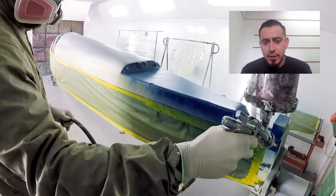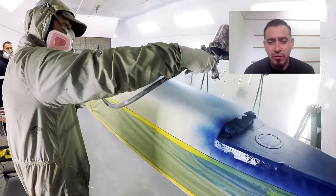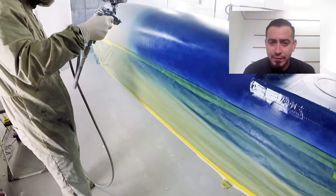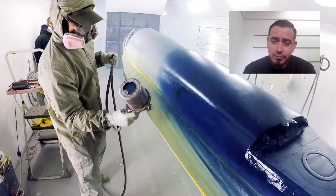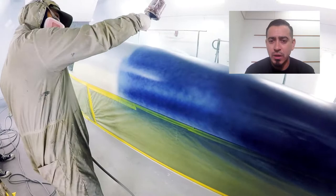When we start spraying the blue, the first coat is definitely a light coat. A lot of people talk about a fog coat — you can do that, but we tend to go a little heavier. You can see he fogs on the paint but goes right back over it to get it a little darker. After that light coat, open up the gun, get a little more paint out of it, and do two wet coats. We recommend a total of three coats with any top coat, whether it's aerothane or poly tone.